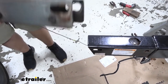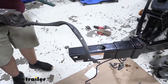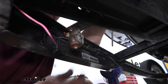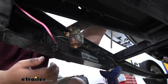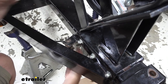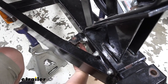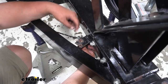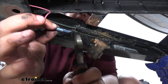So now we will remove our actuator — looks like we got half of it. And there's the rest of it with our hydraulic line on the back. After we removed our lines going to the actuator, all we have left is this power wire and our hydraulic line coming off the back. We'll have to remove two Phillips head screws on the top of our reservoir to get the reservoir off of the trailer. We'll take these off and set them aside because we will be reusing them. Our next step will be to remove this wire — we're going to cut it right here before the stock plug connector, so we'll snip that and let that dangle.